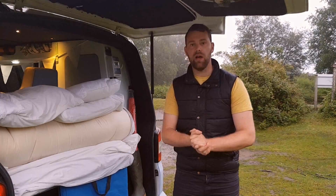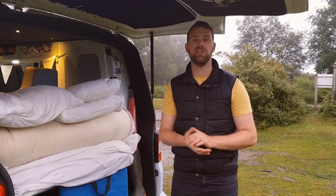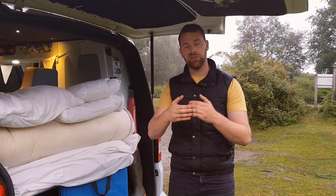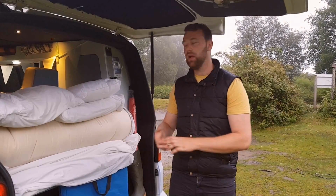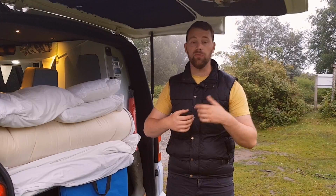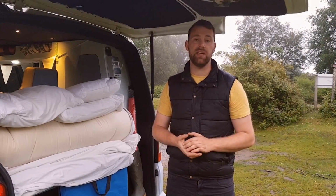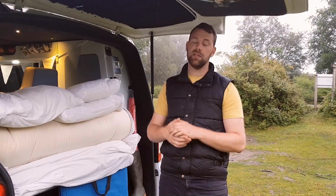So in a country like the UK, when it doesn't get that hot or we don't have that strong sun, and a lot of our summers are a bit overcast, the system to probably use is a PWM. And also, if you're below 150 watt, the system to probably use is a PWM. Now, the reason I went for an MPPT is because when we use the van, we often go to Europe in it for a month at a time. You get hotter days over there, you get more power on the solar panel. Some days this thing goes up to 3.5 amps.